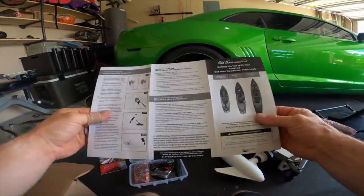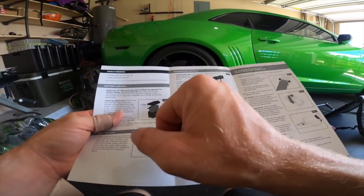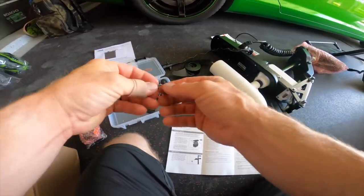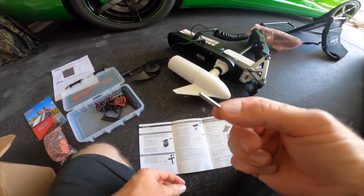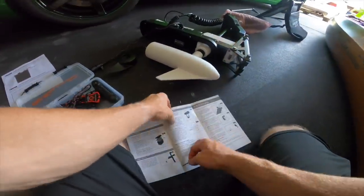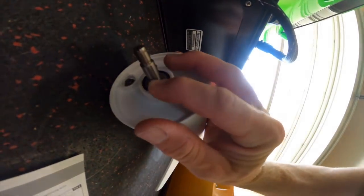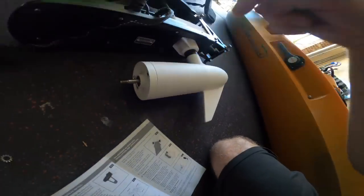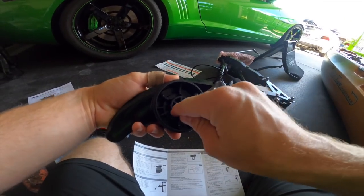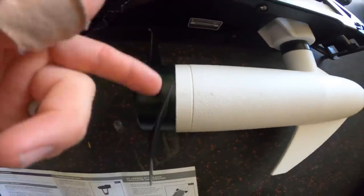Installation and operation - I'm going to read through this and give you guys the cliff notes. Locate the prop pin, star washer, and nut in the battery box. This is the drive pin and prop pin, and this is the star washer. Slide the prop pin through the hole in the prop shaft and center it horizontally so it doesn't shift. Slide the prop onto the shaft - here's where that prop pin is going to rest to spin the blade. Toss that on there - that's now sitting flush.